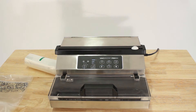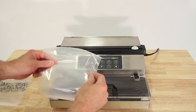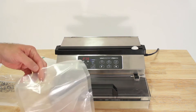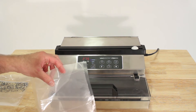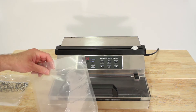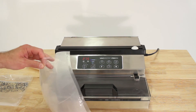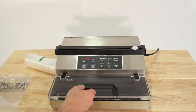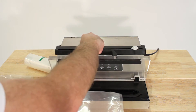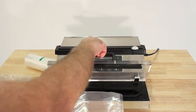Power up the machine. We're going to seal one end of the bag because both ends are open right now. This is a full mesh bag, which only works on suction machines — the regular bags from other vacuum sealers or chamber machines will not work in this machine. You must use the full mesh bag and seal one end first. Lay it over the seal bar here in the chamber.